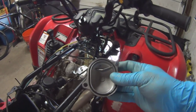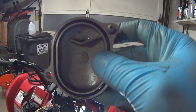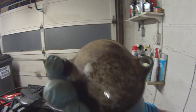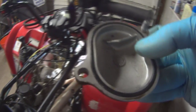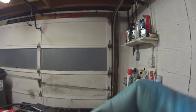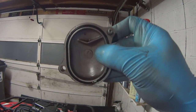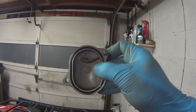On the exhaust cover, make sure this little thing is facing up. It's basically collecting oil and drips it right down on the valve, so don't put it upside down. There's no indication anywhere whether it should be up or down — no marking of any kind on this one — but it has to go like that, with this up. Otherwise it'll hit the valve if you do it the other way, plus it won't drip the oil right on the valve where it should. Just something to remember.